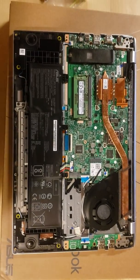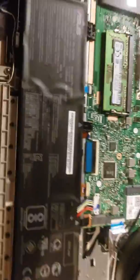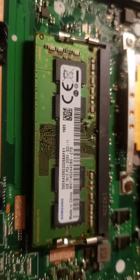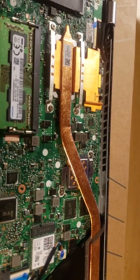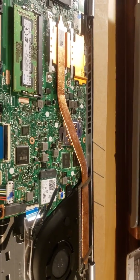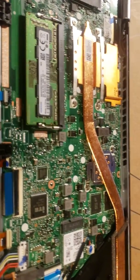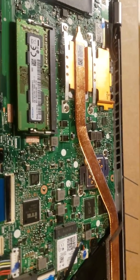There are six short and four long screws — the three across the middle and the one directly at the top are longer than the others. We have a 4GB 2666-speed RAM already on the motherboard, and it does appear that the other slots are soldered. The heat pipe is a little smallish; I've seen this design recently from a couple other manufacturers, mostly some HPs, and they're definitely not as thick or as wide as this one — so that's a good sign.